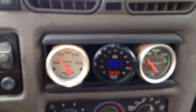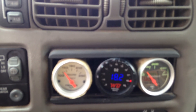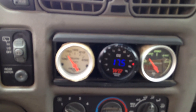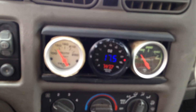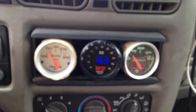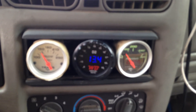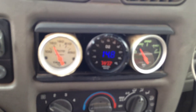Got to get the data log going on this — see what it's trying to command for air-fuel. It just seems like it's a few points too lean, but that could definitely be an exhaust leak. Now that it's hotter, everything's hotter — look, it's coming back towards normal. If the heat expands the exhaust pipes to where that leak goes down, as soon as you rev a little bit it senses it. Full load at 1200-1300 RPM — that's full throttle. I'm gonna guess there's just a really shitty exhaust leak somewhere.